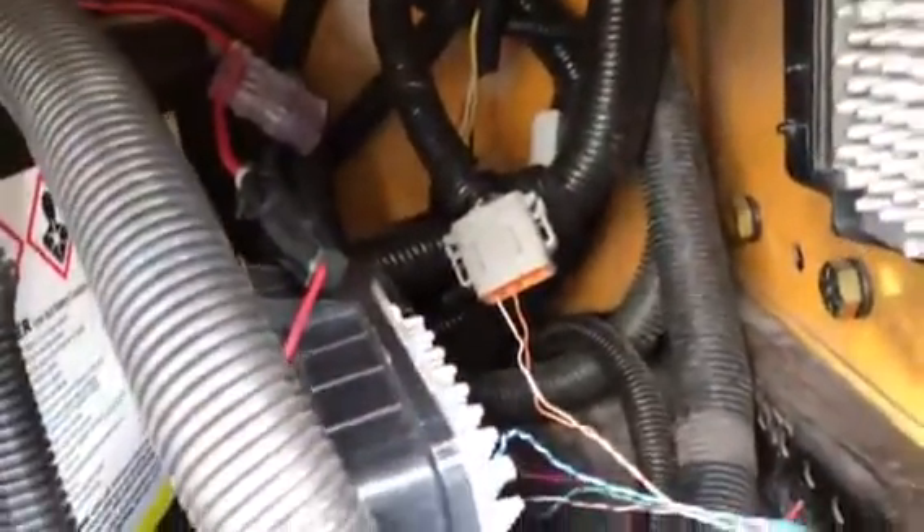We have our TCM — I've been using a test TCM on this one — and this test TCM is the one running through EFI Live. I connected this side already. This was a CAC wiring harness because I had their box and I took it off, and I found that their wires — the yellow and white — actually go to CAN1 on the TCM. This TCM, an A41, has CAN1 as a J1939 link.